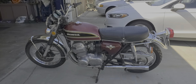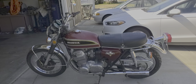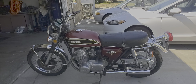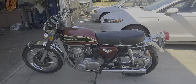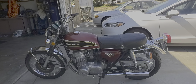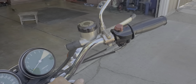I took the carbs off and cleaned them, rebuilt the air box — new seal between the upper and lower half, new air cleaner. Somebody had a K&N in there and I generally don't like those unless a bike's been rejetted, and this one hasn't. When I went in to clean the carbs they were stock jets, so I took the K&N out and put a stock-type air filter element back in, with new adapters at the carburetor. The intake side adapters were in good shape so I left those. Everything pretty much works the way it's supposed to.